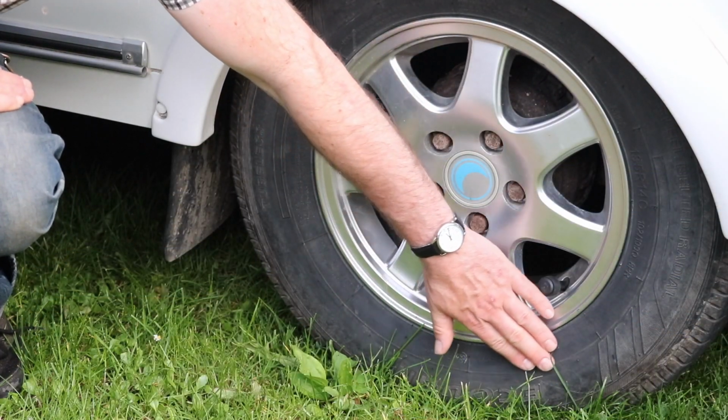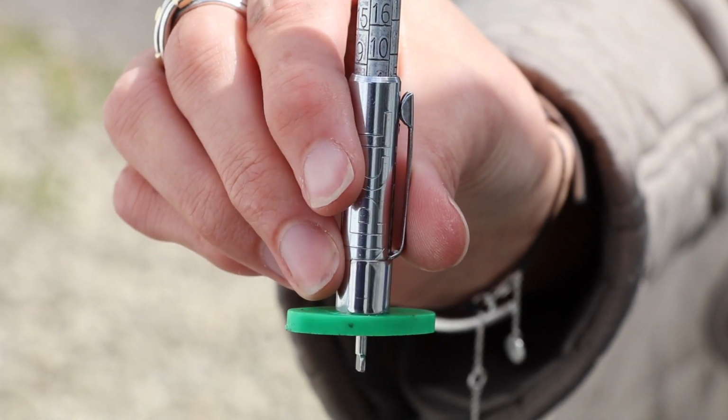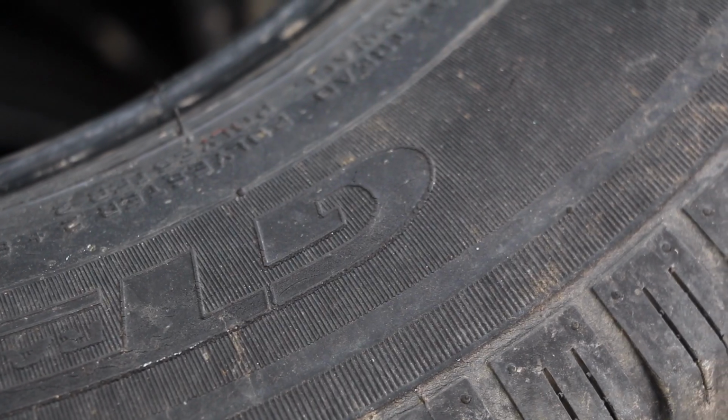Another thing to prevent snaking, and of course of checking your caravan as well as your load distribution, is the tyres. Your tyres on your caravan are the only contact you've got with the road surface. Tyre pressures, tyre tread depth, age of tyres, the condition of the tyres. Just because they look good on the tyre tread doesn't mean to say the tyre walls have eroded and collapsing.